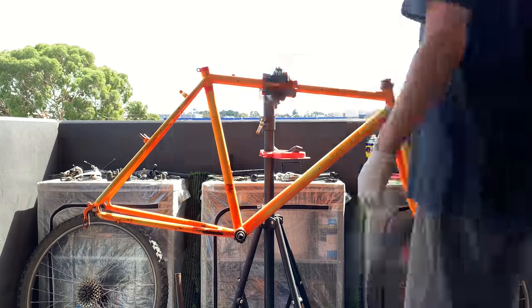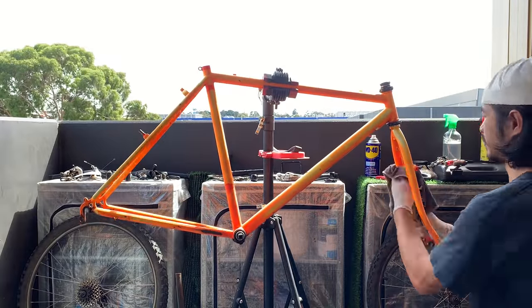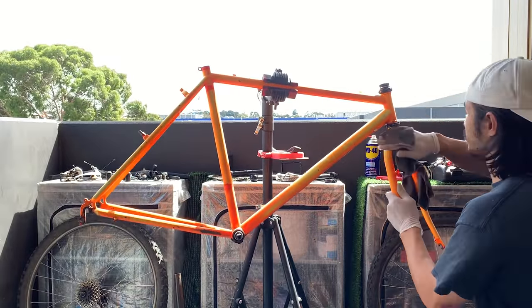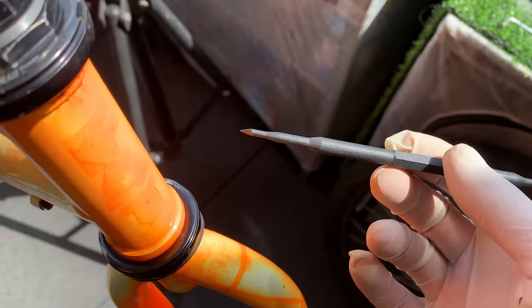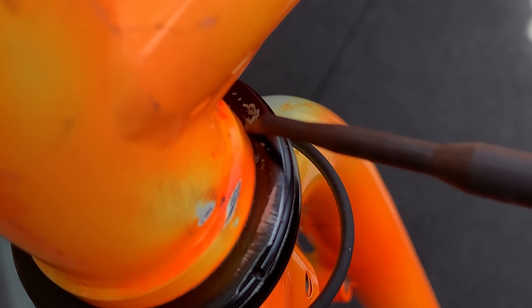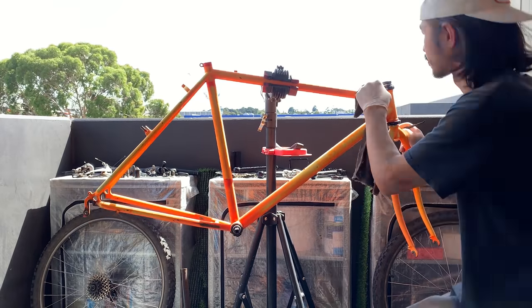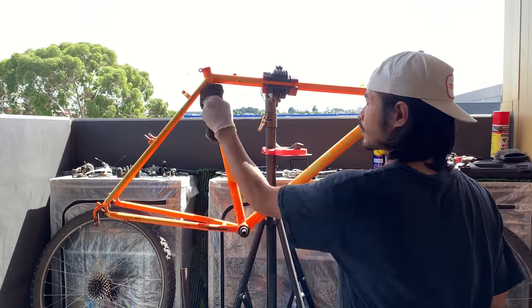Here, just spraying down the bike with my soap mix. So Dove soap, a little bit of detergent, and just water, and you shake it up in the bottle, and then just spray it down. And then here, using the seal pick from BEAUT BIKE again. I'll put a link in the description. It's good for scraping areas where your towel won't get into. I use it around the headset, around the BB, and that helps as well.